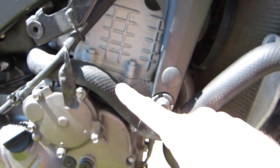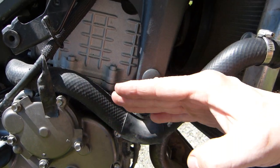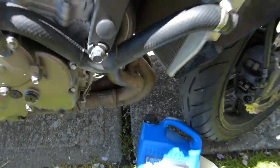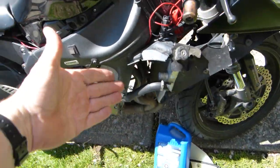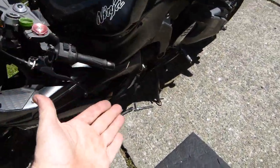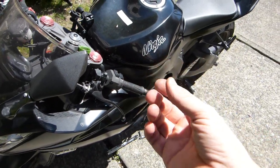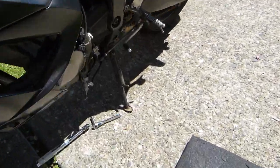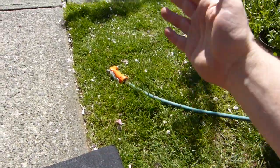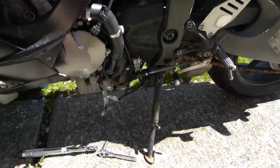And you see the drain, you can see there are dips in this coolant line, so not everything is going to drain out from the coolant system. There are going to be puddles here that need to be drained out into the same container, of course. But this is the point of flushing, so any remaining residual puddles are flushed out, as well as any sediment that settles inside the radiator and inside the engine blocks, fine passageways. Okay, so that's why I use pressurized air and pressurized water to actually flush everything, force everything out of the system. Okay, and let me show you how I do it.